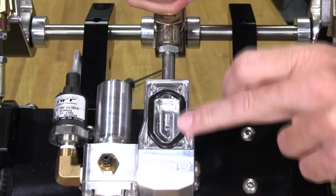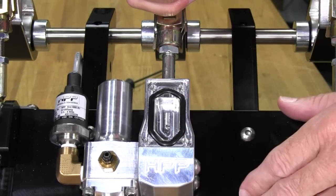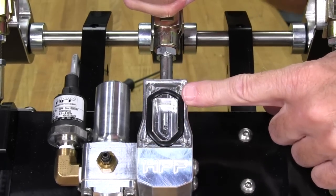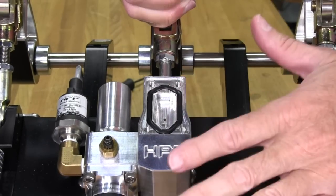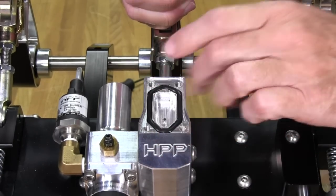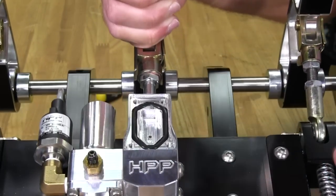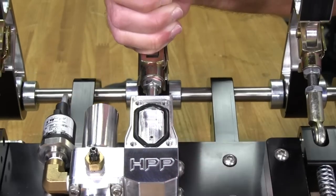And there's what looks like a little bleeder hole in there to keep things equalized. You've got your O-ring over here to seal everything up. And at the shop, when Mark bleeds these out, once he's got it bled out using this valve over here, he sucks out any of the brake fluid that's still in that little reservoir part there, and that means it's all inside of here and over here in the slave cylinder.